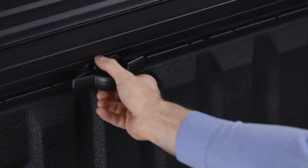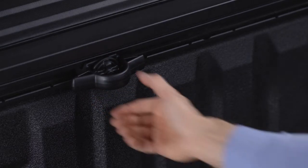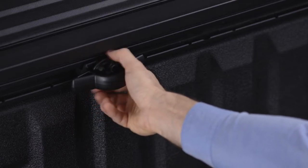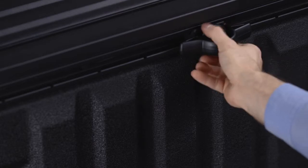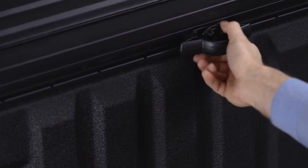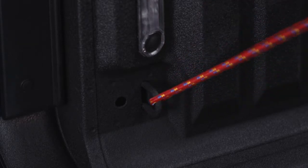your cargo. Locate each cleat, then tighten it into one of the side rail positions, and you've got a secure tie-down loop. To move the cleat along the rail, turn the nut several times counterclockwise, pull outward, and slide the cleat to the desired side rail position. Then set the cleat and tighten it down. You'll also find tie-down hooks at each corner of the bed near the floor.